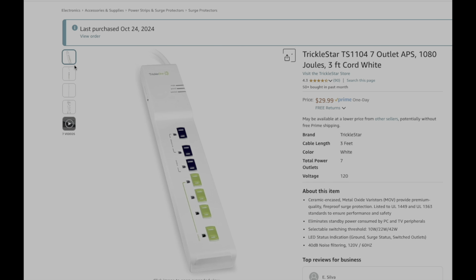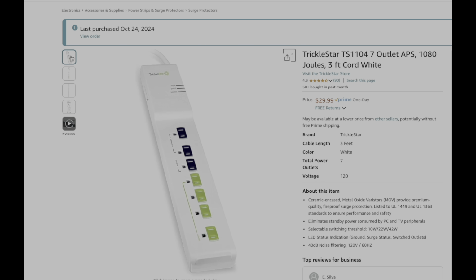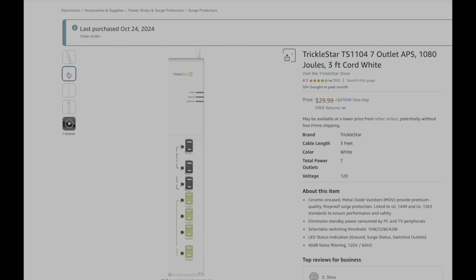So these still take power even when they're on that auto standby mode. What I did was I searched on Amazon and found these 2 power strips that are very affordable. The way they work is, if something turns on, it'll turn on other devices. So this is perfect. If the pre-pro turns on when it's plugged into this section here, it'll turn on all the other devices connected on this side. And keep in mind that you can connect another power strip, just a normal power strip, to the area that is the remote, and you can add more devices that way. You don't have to keep getting the same exact device. All you need is the one function where if something turns on, it turns other things on, and when something turns off, the other devices turn off as well.